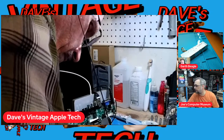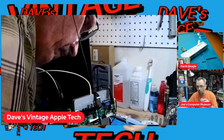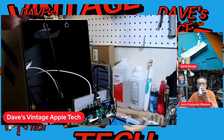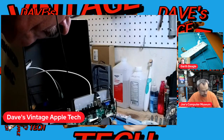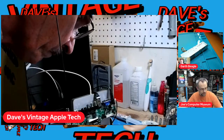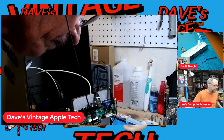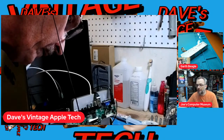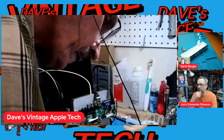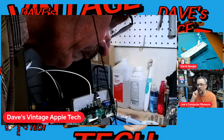Yeah, it's funny because I think I mentioned in another stream, I have a couple of LC 575 boards that are just not working in various states. And I'm realizing I can't really troubleshoot them outside of the chassis with some sort of power and the harness. How do you do this? So I will say this, it's pretty obvious they have trace damage around the CPU socket. That's not fun. Might be pulling off the socket on at least one of those, but that's where you find yourself an old dead 550 or something that has a dead tube. And you just scavenge the crap out of that to make a test chassis.